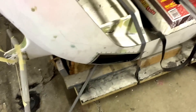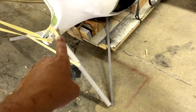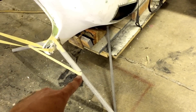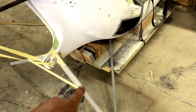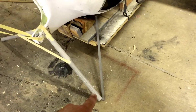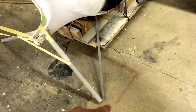You can see the front wheel area — this is how you turn it. Lots of room down here. Of course, it's still sitting on pallets since I don't have the wheels yet. This is where the drag tube is going to go, just up underneath there. We're going to have 60 inches outside-to-outside of the tire. There'll be a bracket and an aluminum tie rod here. We've got an inch-and-a-half fiberglass rod over the top of an inch-and-a-quarter fiberglass rod, and inside that is a one-inch 0.035-wall tube which will come out here and be welded to the axle.